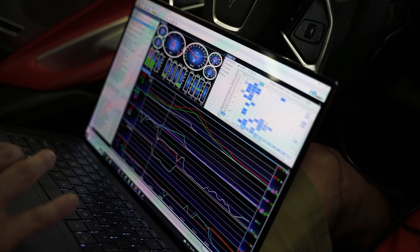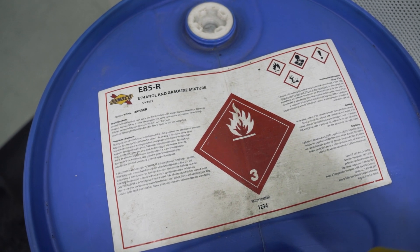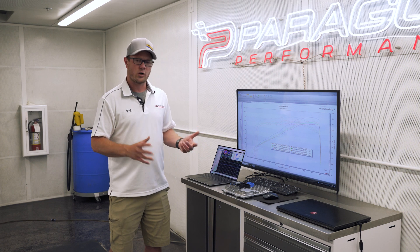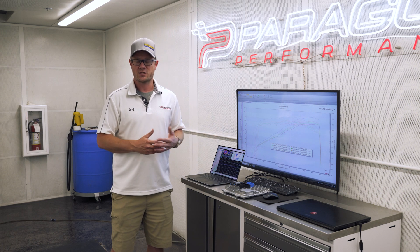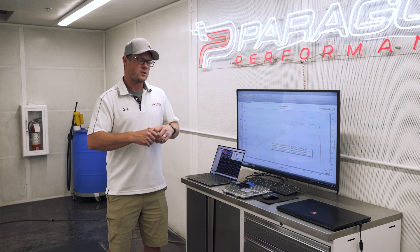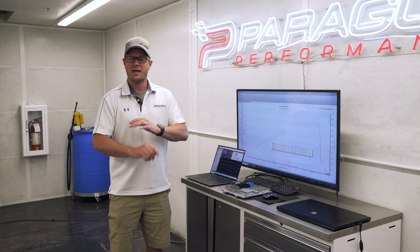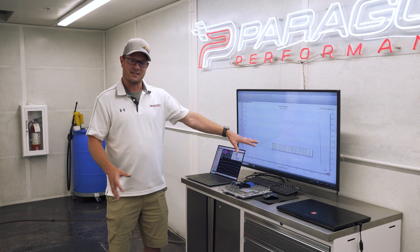We're going to take a deeper dive into the tuning in a future video. But for today, people curious about E85 or E30 mixes, or saying you could just put some E85 in these cars and the ECU can adjust — to a degree that's true. The ECM in these cars is full-time closed-loop fuel control, which means it can use the trims to adjust for ethanol. But it's not nearly as ideal as specifically tuning the car for E85, which is what we did today. We told the ECM the car has E85 in it, so all the fueling, fuel trims, ignition timing, and ignition angle have been optimized for E85. That lets it run safe, smooth, consistent, and make this kind of power.